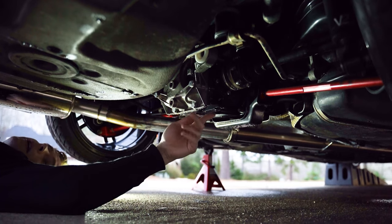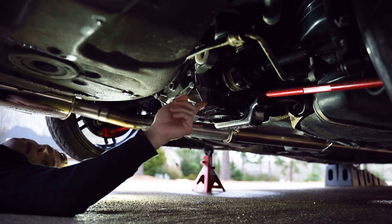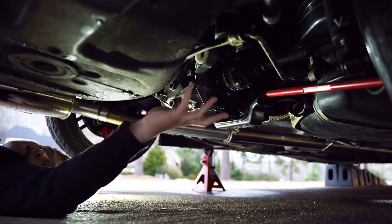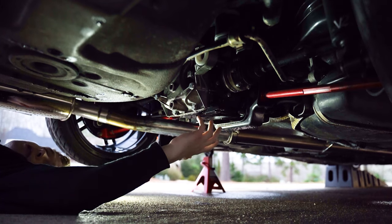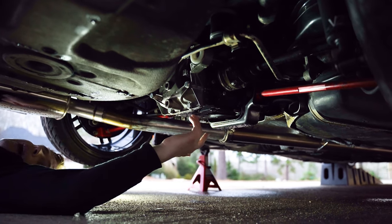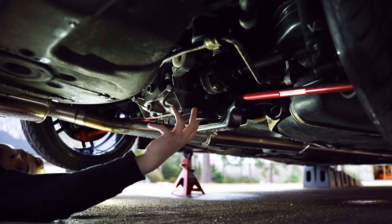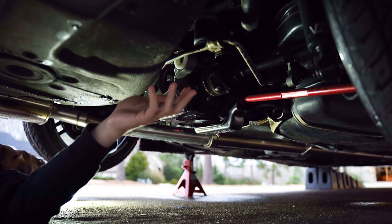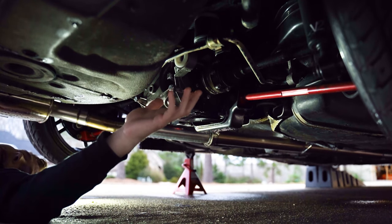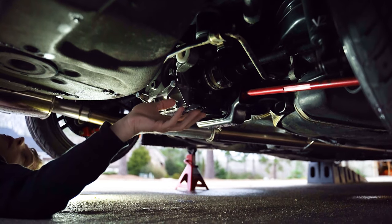as well as the front of the casing for the front mount has actually been drilled and tapped for a 14 millimeter bolt upgrade. Now, to do that requires replacing the bushing in the subframe, which is the front diff bushing, with a specialty bushing with an oversized hole. Condor makes that and they sell it as a complete kit. It's fantastic. You'll hear me talk about this on this car as we go through it. Every single thing on this car is Condor Speed Shop. I have every part that they make on this car and I would not change a thing.